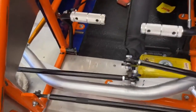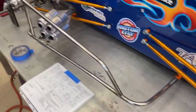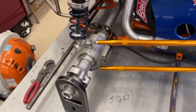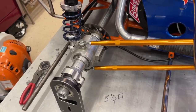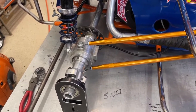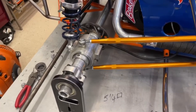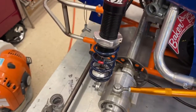So where we start is we start at the back of the car first, and we want to make sure this axle is square. There's a couple of places to check to make sure that it's square. These cars will move around a little bit - every time we adjust one of these cars after a race weekend, we come back, tear it all apart, check it, and it's amazing how things will be off a 16th or an 8th here and there, even though everything was tightened down, you weren't in any wrecks, it was a smooth weekend - they just seem to move around ever so slightly.